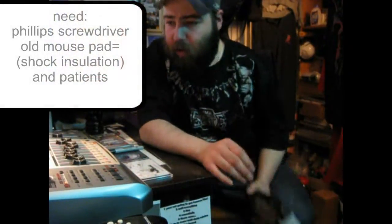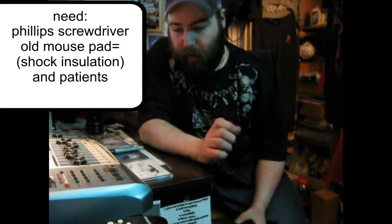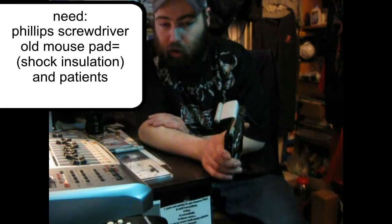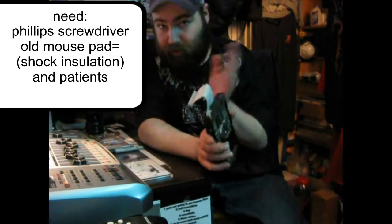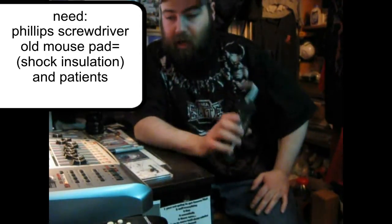This is a tutorial on how to diagnose and repair or replace the hard drive in a Boss BR1180 digital recording studio. The biggest thing is diagnosing it. If you get the message that says HDD error or drive busy, the drive is busy and clogged up. You're going to need to erase it or initialize it.